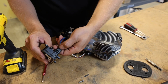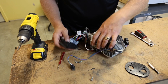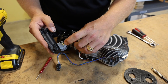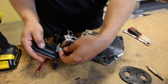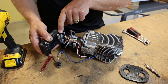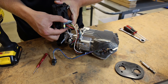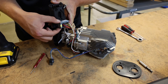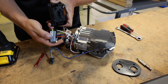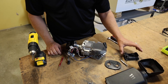This plug is pretty easy — there's a little tab on the very back, you just push down on this tab, give it a little wiggle, and it'll unplug. This plug is a little more difficult. You have a yellow safety clip that has to be lifted up first. There's an inner black and an outer gray part of this plug. Hold the ECU firm and pull out on this gray cap on the plug and it'll actually force the plug to go out that way, unplugging it. The ECU is unplugged — be careful with it, they're very lightweight and if you step on it or something, it's going to break.